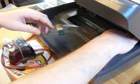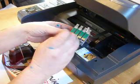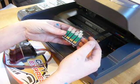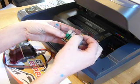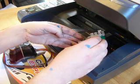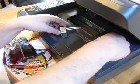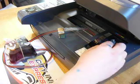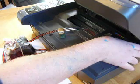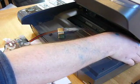When you insert these cartridges, you have to press down very firmly at the front and back of the cartridge. These are auto-reset chips so the ink levels will be monitored as normal. When it tells you the cartridge is empty, press and hold this button for five seconds. You do not need to remove the continuous ink system — just press and hold while it's in the printer. Pop the cartridge block back in and press down, listening for an audible click. If when you switch the printer on the cartridges aren't recognised, remove the cartridge block, pop it back in and press down very firmly at the front and back.